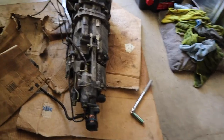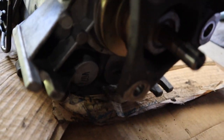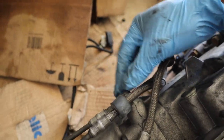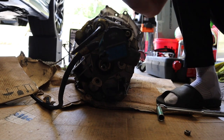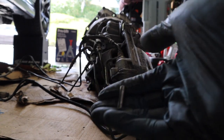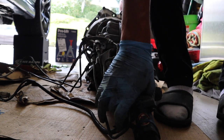It's the start of a new day and I'm going to start taking apart the transmission a little bit. I'm going to start out by taking off this SMG shift actuator right here. From what it looks like, it's just held on by this 13 that I've already started undoing, there's another 10 here, and another 10 under here. I'm going to undo those three, and probably this right here as well because the hard lines are kind of connected to it. With this little pin out from the selector joint, the actuator was able to come off — you're going to need a little punch to get that out. Once you do that, she comes right off.